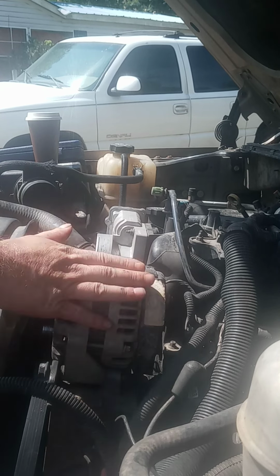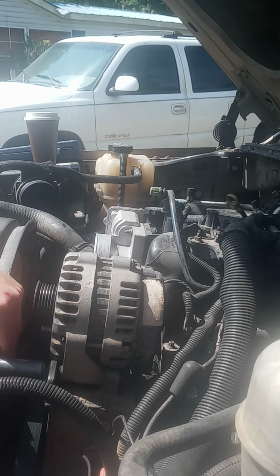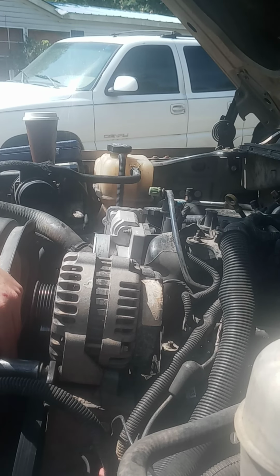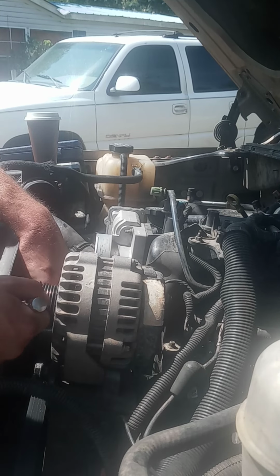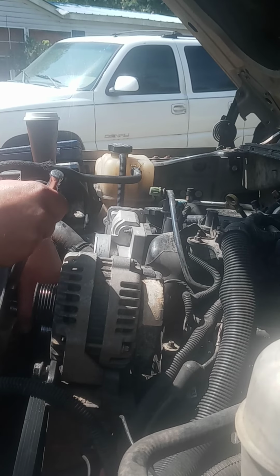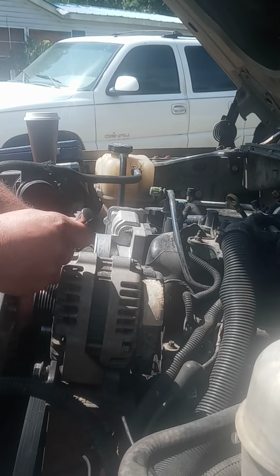So there's multiple different sizes. That one has the biggest size you can get. So if you're looking for an alternator upgrade, it's got a stereo system, and you have a regular Suburban, just go and get a GMC Denali XL alternator, because it's bigger. The AC system and all the other extra electronics you don't have in the normal vehicles take that extra alternator to run all that stuff. So if you got an amp and speakers, just a simple upgrade. All the wiring's the same.